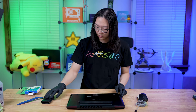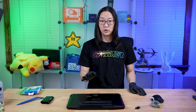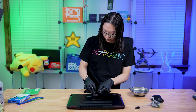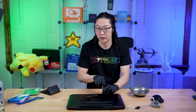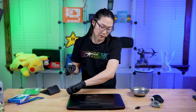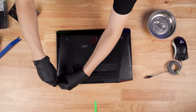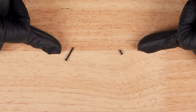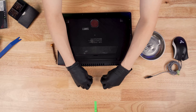We've got the back of the laptop here and we're just going to take our toolkit and take all these screws out. Whenever you disassemble a product like this, I always recommend you use a parts tray. Looks like these are all standard Phillips type screws. Usually all the screws on the back of a laptop are the same style, same depth — but always double check because it can always be different. There are two different screws right here, so we want to make sure we remember where those came from. The ones up here, closest to the bumper, are the long ones.